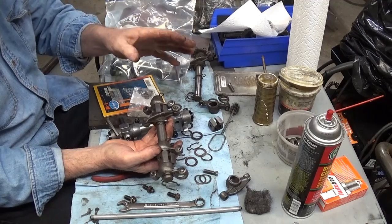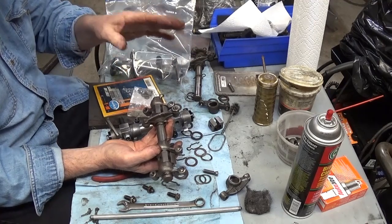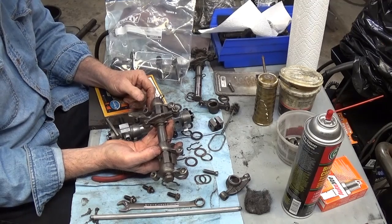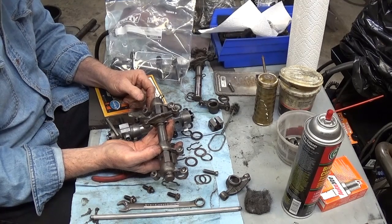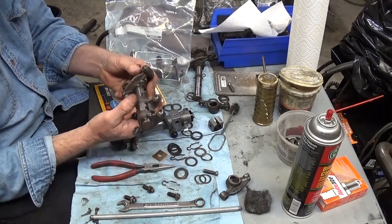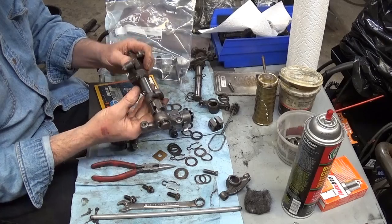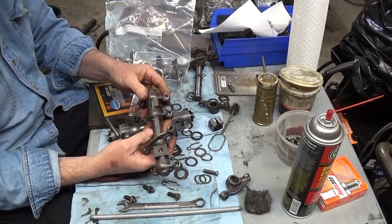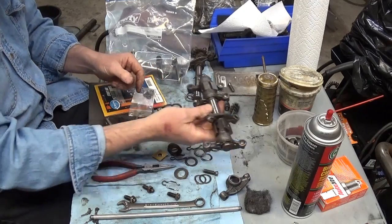If you are revving it high and redlining it every time you shift, showing off for your buddies constantly, it's going to trash your heads. Your valve guides, your seats might come loose. That can be catastrophic. It happens to a lot of guys. They build a nice engine, and then they don't do the valve train right, and it comes apart on them, and it'll ruin your day.